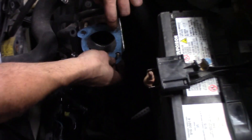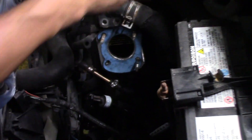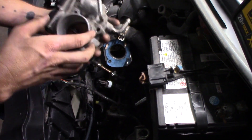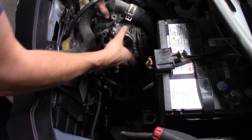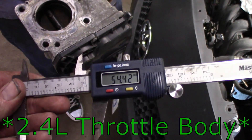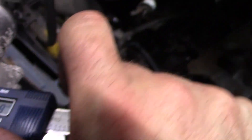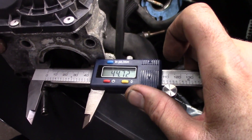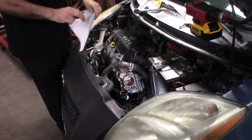What we forgot to do — let's put this blue gasket on here first that we made. Now I'll seal her up a little better with some good old metal on metal. Now we can put the throttle body on — the big one, not the little one. We measured the stock throttle body at about 44 millimeters, and the new one is about 55 millimeters. So we got a 10 millimeter increase here — I think we'll make some power. It does look a little big on there.